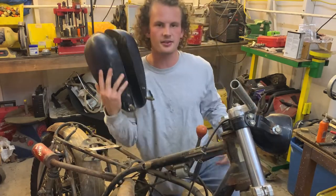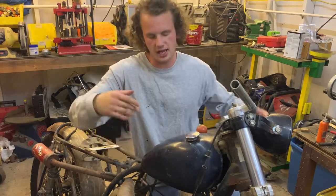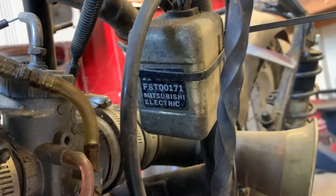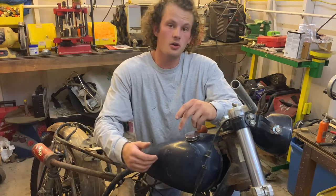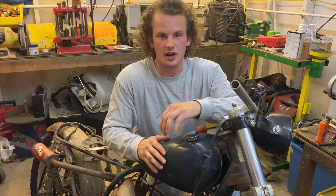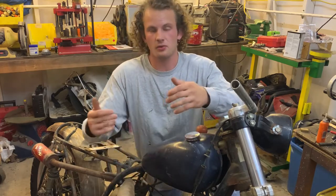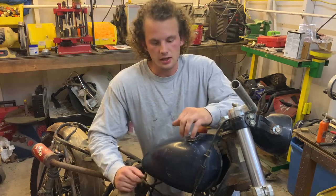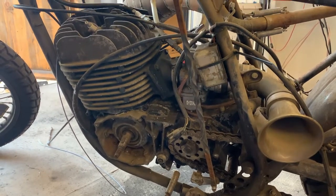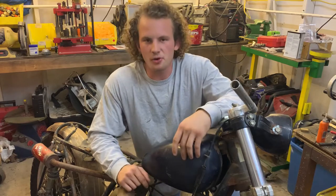There's quite a few things to button up. We're going to redo the fuel system — right now the tank isn't even mounted, the petcocks leak, and there are no lines. For the electrical: last time you saw this bike we got it started for a few minutes, but the next time I tried to start it there was no spark. The pulsar coil is showing an open circuit, so we're looking into doing a whole entire stator system switchover.